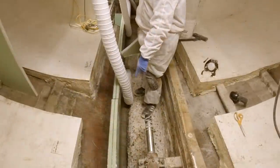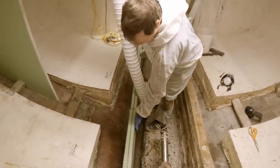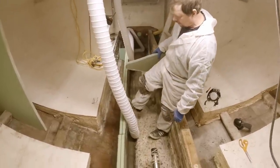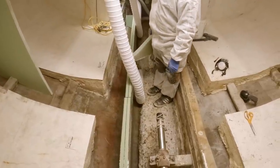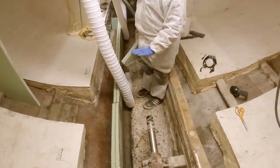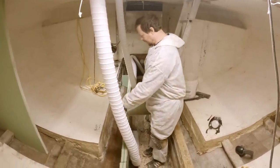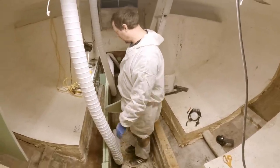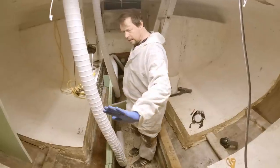There's an incredible amount of strength in here. You've got a lot of compressive strength, the way these are laid up, and then you have it tabbed in. These don't wiggle at all. And they'll only get more stiff as you put foam back in here and concrete on the other side. We'll stiffen them up even more, so it really does create a good backbone in here again.